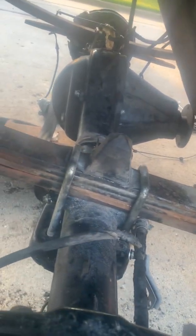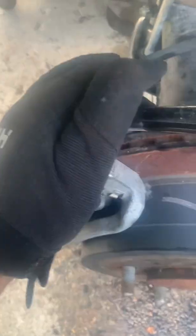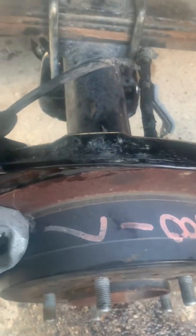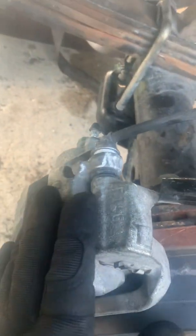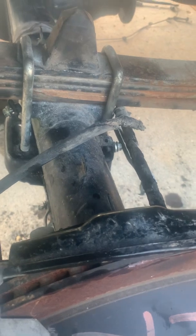The unit I received from the junkyard is a 2020. The main difference is that the stud nuts are 19mm on the 2020, whereas from 2007 to maybe 2013 they are 17mm. Eventually I'll be reusing those, but I'll have to open up the whole thing and reuse my emergency brake line, attaching that again. Hopefully I'll just be able to drive the car after that.